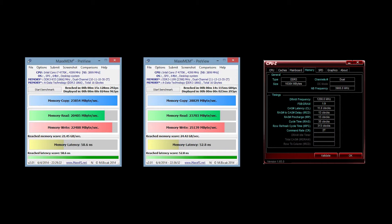2800 megahertz did not work out — the motherboard rejected those settings no matter what they were. Regardless of timings or voltage, the motherboard just would not get past the initial initialization stage and had to be reset with the MemOK button. But it's nice and easy to bring it right back down to 2400 and you do see an improvement, so that's always nice. As always, if you enjoyed this video, please subscribe and come back soon.